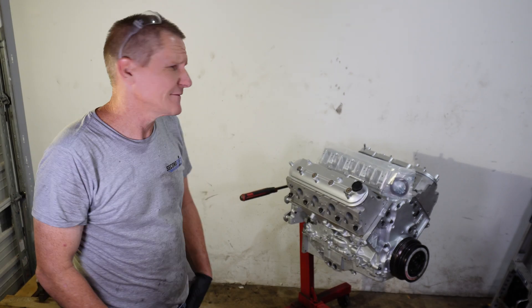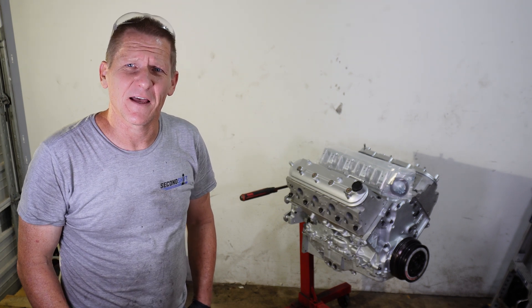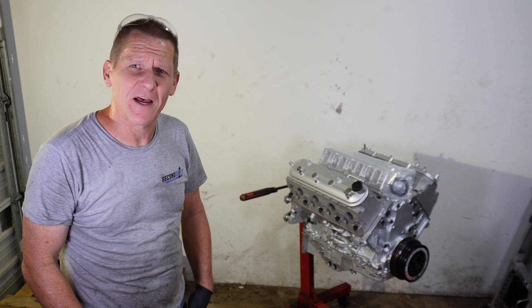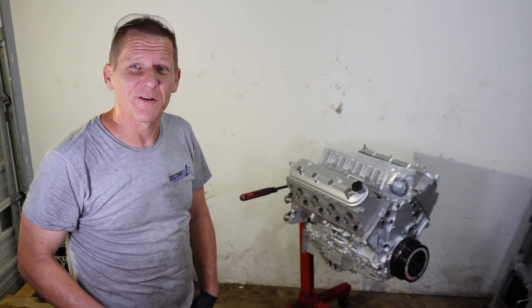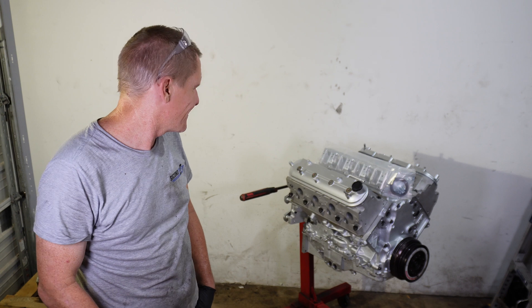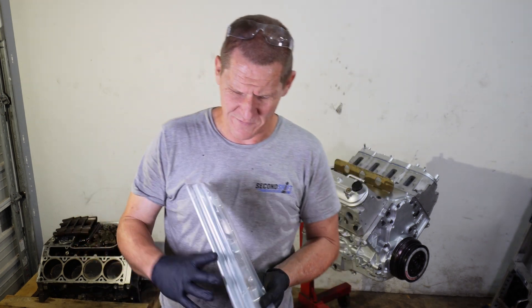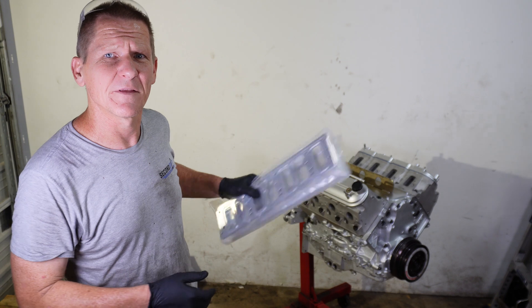The motor is all back together. From this moment forward the L9H engine identifies as an LS7 — it's got the long-snout crankshaft from the rare LS3, it's got the ATI super damper underdrive pulley for the LS7, it's got the LS7 oil pan, and it even has an LS7 camshaft in it. We're going to use these awesome aluminum adapter plates from CBM Motorsports to reuse the LS7 intake manifold on the LS3-style engine.